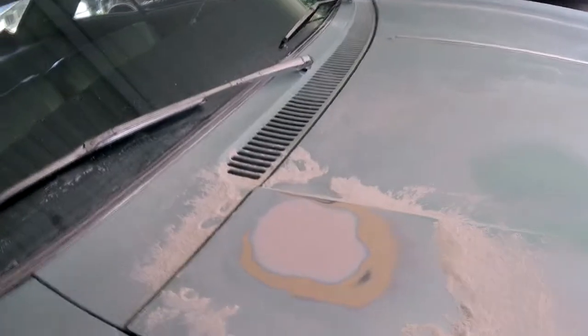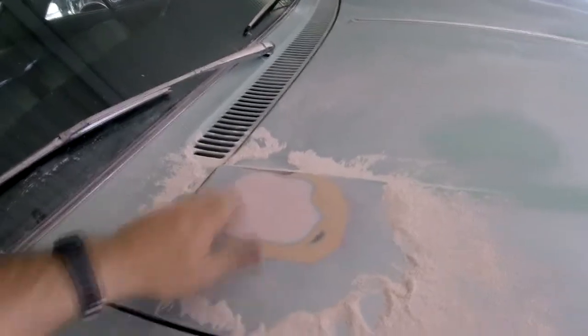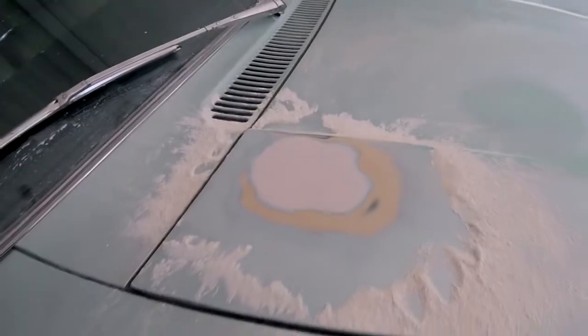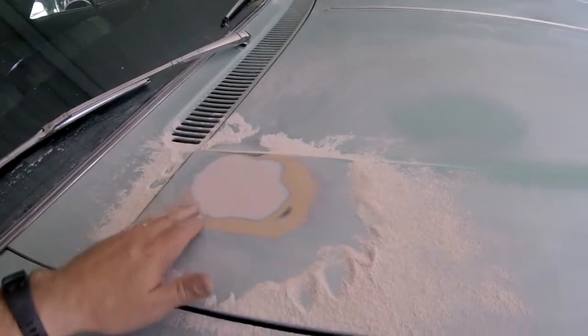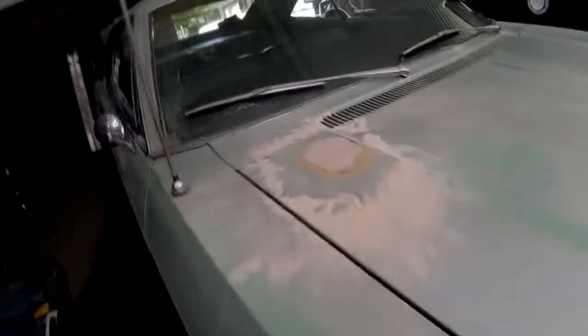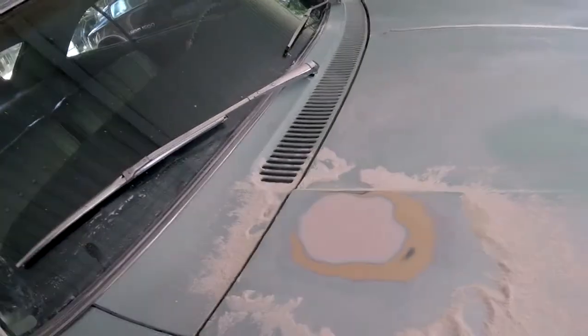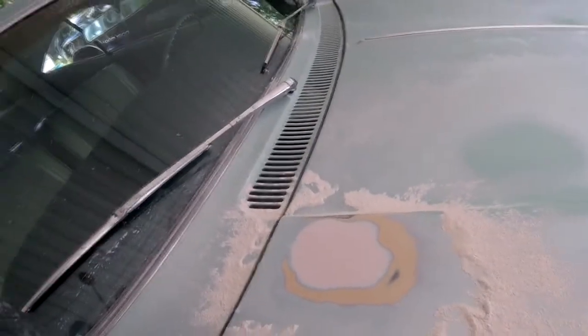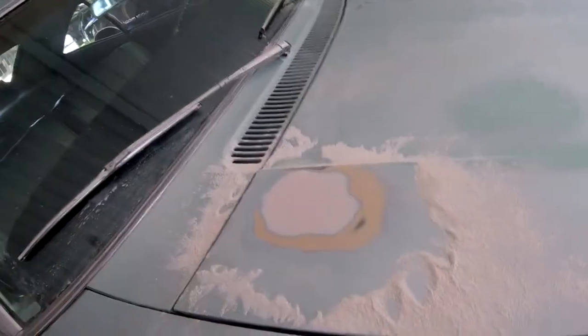Okay, so after a lot of bondo, not a lot this way, but a lot this way. It's way too much, see all that sand? That dust just piling up. But it looks pretty good. Feathery smooth, I don't feel any edges. Feels really good. So now I just got this monster to work on right here. That bondo, whoo! You better be ready, because that stuff sets up super quick. It's been a long time since I've used that, and it set up so fast. So be ready, prepared, have everything ready, and smooth it on, and don't worry about little layers, because then it just hardens. So be careful.